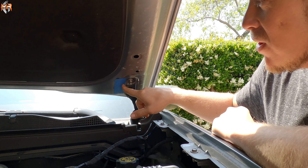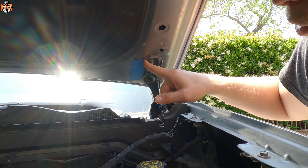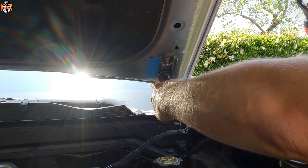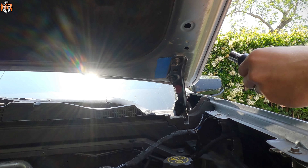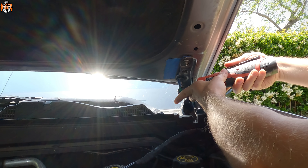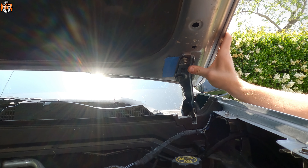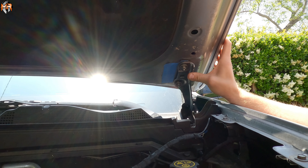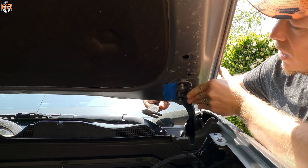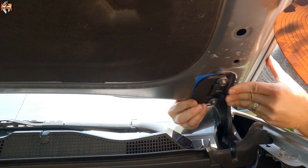The first thing we want to do is mark around the hood hinge. I've installed a piece of painter's tape here so I can realign the bracket if it shifts when we remove these bolts, so there are no alignment issues with the hood. Now since I have a line to follow, I'm going to loosen these bolts — you don't have to remove them altogether, just enough so the bracket can squeeze through. Notice there was a little shift when I loosened the back one, and that's what the tape is for. Now I'm going to grab the M&R bracket and insert it behind the washers.